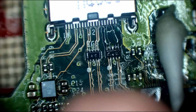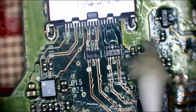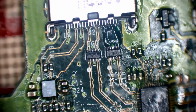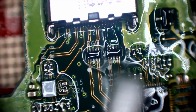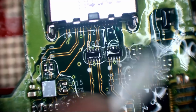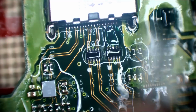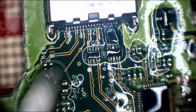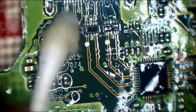Then it's going to be repairable in the future if the port ever gets broken again, without having to redo trace repair. That's the entire point of the conformal coating, to protect the jumper wires from falling off. I can use hot air around it, I can use a soldering iron around it. Shouldn't be an issue.